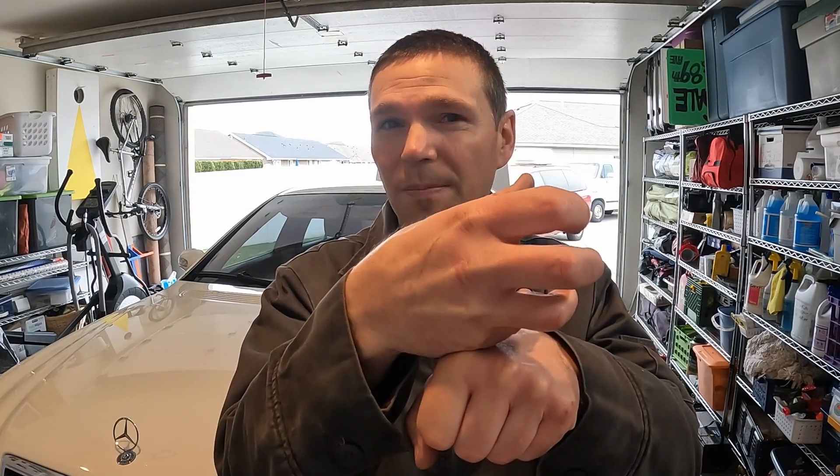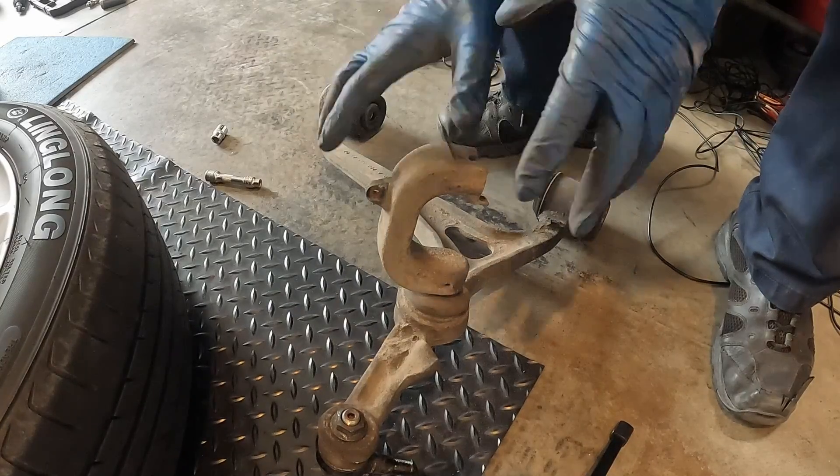I think we've got our noise pinpointed. On this particular setup, the strut tower is connected to a little bracket, and that middle bracket at the bottom has a ball joint that connects to your lower control arm, allowing that strut to flex. That ball joint is what's making our noise. Unfortunately, you can't replace that ball joint by itself — the whole lower control arm has to be replaced. With the control arm removed, check out our noise.